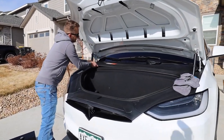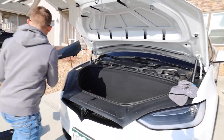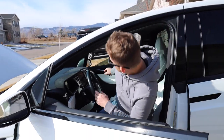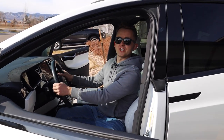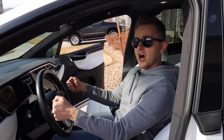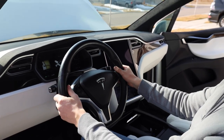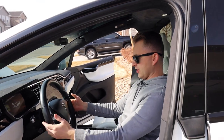We're going to remove this panel right here — it's just all in clips, so you just pull it. One more thing worth mentioning: you want to make sure that the steering wheel is perfectly straight. That way when you put the new one in, you don't have to try to adjust and figure out what's straight and what's not. So that when you pop that yoke in, you have a perfectly straight steering wheel. It looks perfectly straight, so we're good.